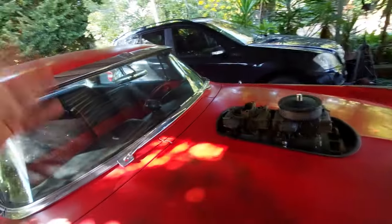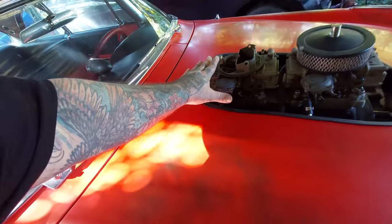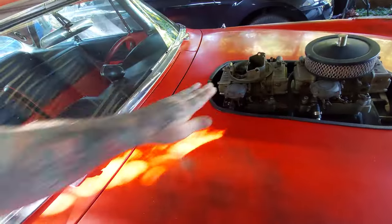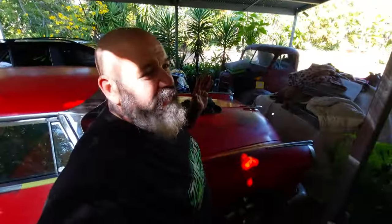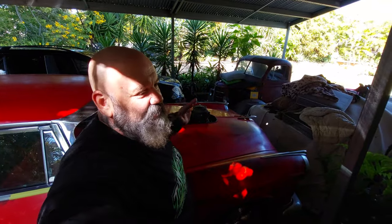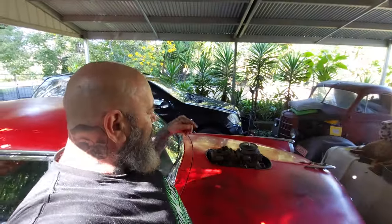Okay, so we're back. Now, what we've done is we really struggled to get that float level down to stop it coming out of here. And I think that our pressure reg is not any good. I don't know. I've backed the pressure reg right off and I still can't get the gauge to drop. See, I took 3 or 4 turns out of it to drop the pressure. The gauge still isn't working, so I'm going to go and replace the pressure regulator because it looks like it's just a cheap eBay one.